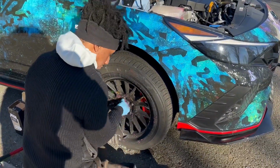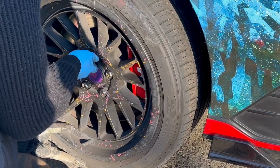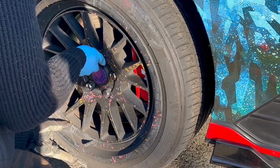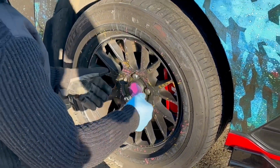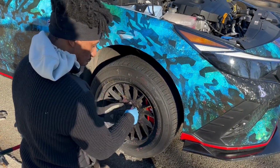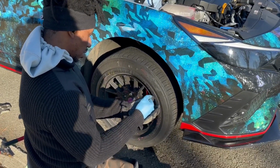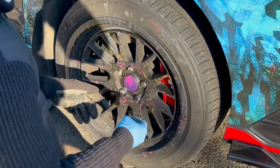You want to hand tighten them, because a lot of the time, if you just go ahead and place the gun on it or start torquing it down right away, you can start to damage the threads. What's going to happen is the wheel is going to sit kind of weird on the hub, and some of your wheel is sitting on that particular bolt, and the other ones get a little out of proportion.